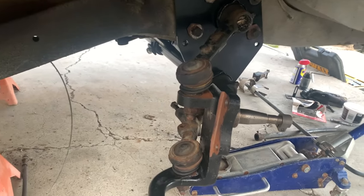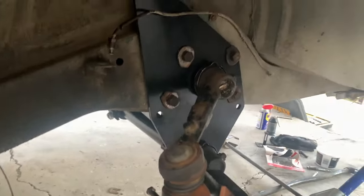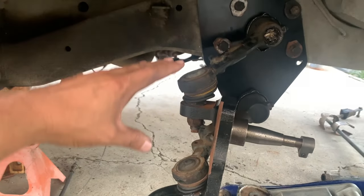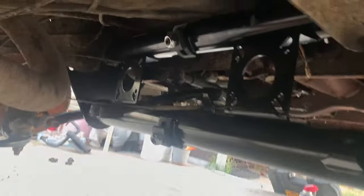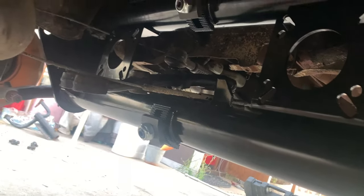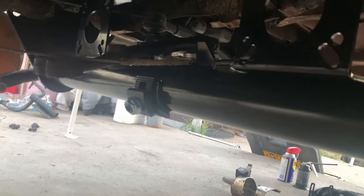The secret to getting that lined up was to loosen up the adjusters, which allowed me to freely move the swing arms and move them up into position in order to line them up with the holes for the spindle. The main problem is that now my adjusters are in the middle somewhere, and I have a feeling I'm gonna need them adjusted all the way down.